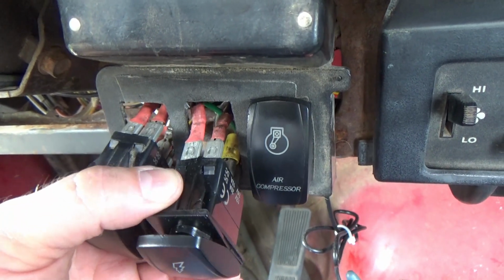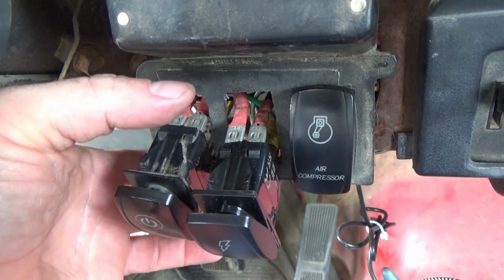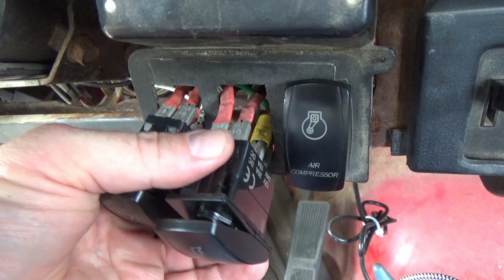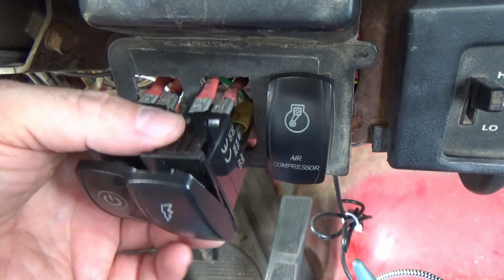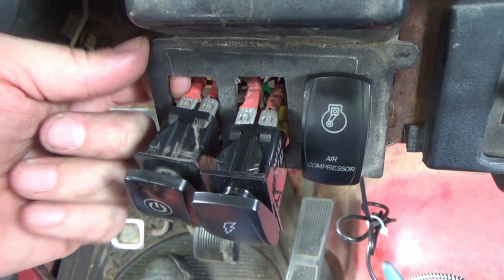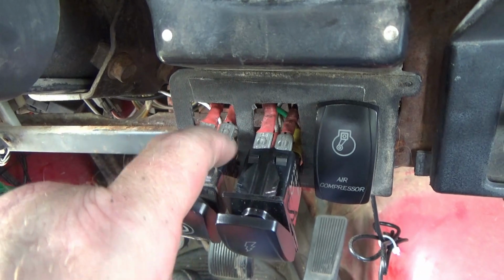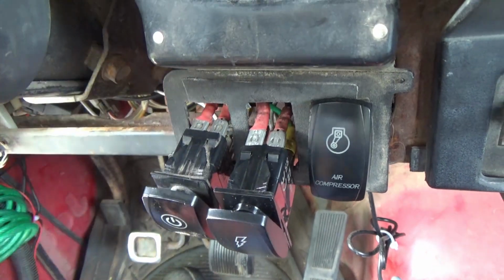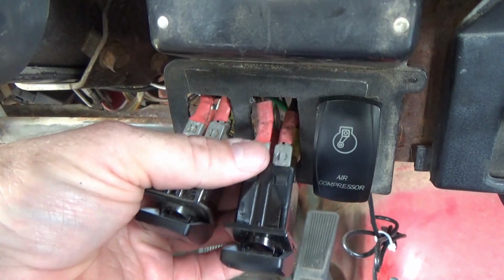But let me give you guys a little bit of a hint. If you go back and watch the videos where I went from a toggle switch to start this thing, then I wired these in to start it. Whenever you go to build a harness for these right here, what I want you to do is make your wires a little bit longer, because I've actually made life hard on myself. I've got so little wire to play with to pull the switches out to change everything out. Because you have to stick them through these holes right here, then pop them in the switch. It ain't like you're going to slide the switch back through here. Not going to happen. And on the back side of the harness, there are wires that loop from this switch over to this switch over to this switch, and so on and so on. They loop around the back. So it's not like I can just wire it, stick some wires through here, and call it a day. So make sure you build your harness pigtails a little bit longer to give yourself room to service it later on.